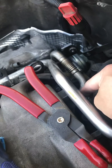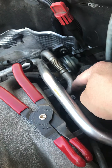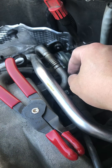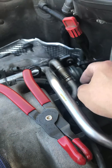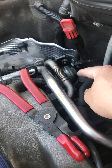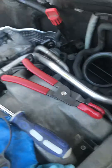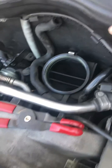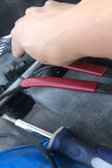This connects to the engine. EGR is exhaust gas recirculation — whatever gases the engine produces, it recirculates them back in so they don't go into the environment. It's basically recycling. There's also this other hose that goes into the nipple for your crankcase breather.